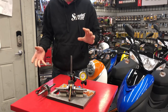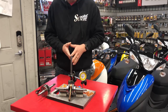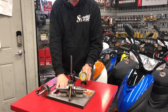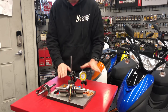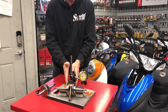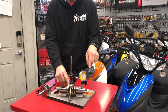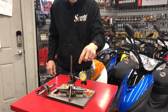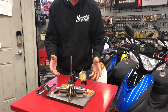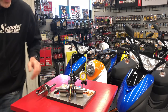What I want to go over is what we do with cranks to verify if they're true and if they're good cranks. This piece of metal has been machined down to be extremely true — my machinist did this. This surface is true, and this setup is held down with magnets. We also have a simple measuring device to check cranks, along with V-blocks — all machined to be true.